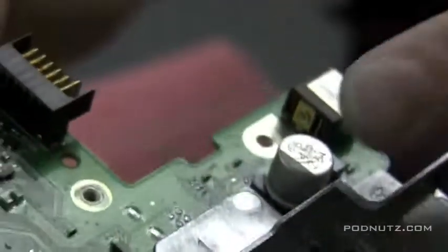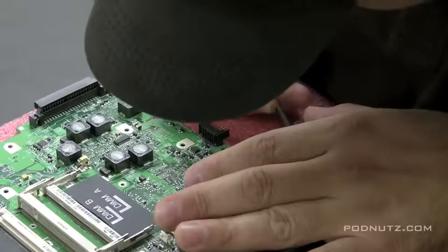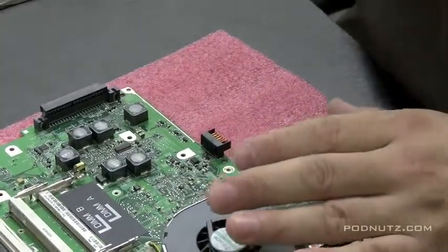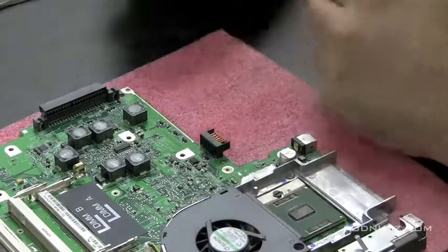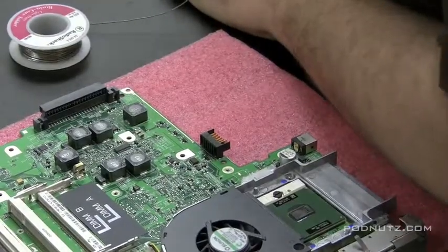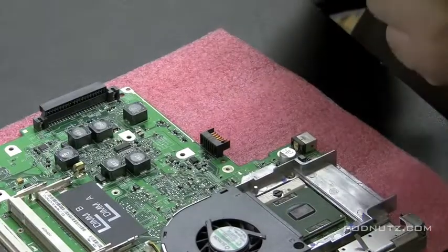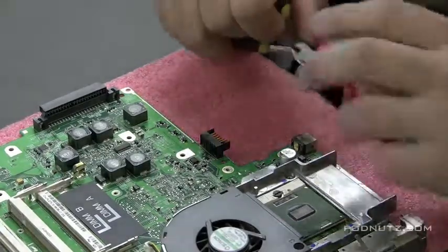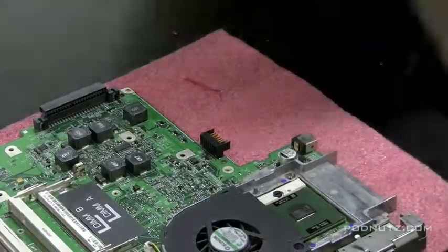The technique I like to use is attaching a wire to reattach the power jack to the motherboard. I use a wire because it has flexibility and won't be as brittle as connecting the actual pin straight to the motherboard. If it breaks once it tends to keep breaking. The wire replaces the actual pin that comes out of the back of the power jack. First I need to file down a bare spot on the motherboard where that pin originally attaches. Then I'll cut a piece of wire the right length to wrap from the top of the power jack around to the underside of the motherboard.